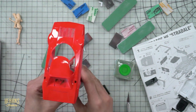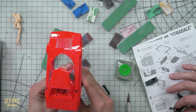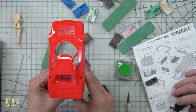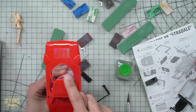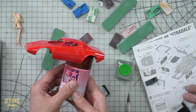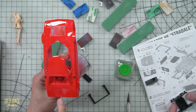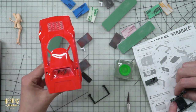And where we've sanded it, it's gone pretty shiny, okay? So it's going to dull off a little bit as it dries because it's going to shrink. Then we'll give it another sand with some really, really fine paper, maybe just 10,000. If we've got to get rid of the dust, we'll probably use something a bit more, rub that back. And then we'll put on probably another couple of coats before the wet coat goes on, and that'll be perfect. I see it's starting to dry across the top here now, so that's starting to dull off a bit. But it's starting to look good.